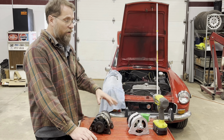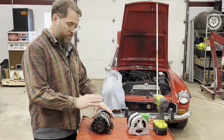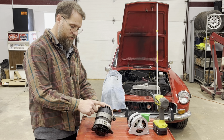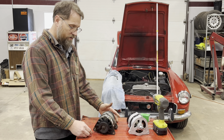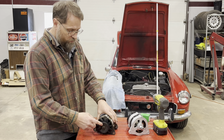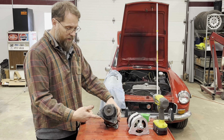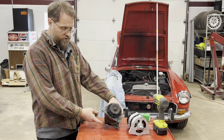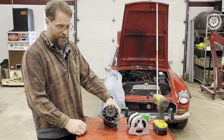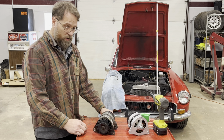If you saw my last video about this car, we were testing the alternator. The alternator was sometimes charging, sometimes not, which would be in the regulator assembly. But the other thing you can look at when you've got it off is you can spin it and see how easily it spins. The brushes really aren't putting much tension on the commutator, which means it's pretty much at the end of its life anyway. It wouldn't have taken much longer before it wouldn't have been charging well enough.